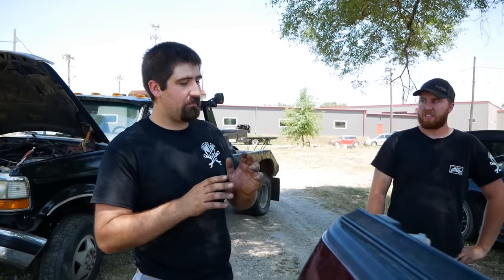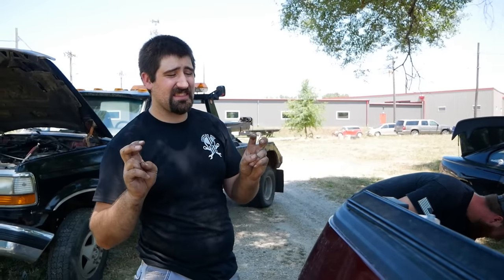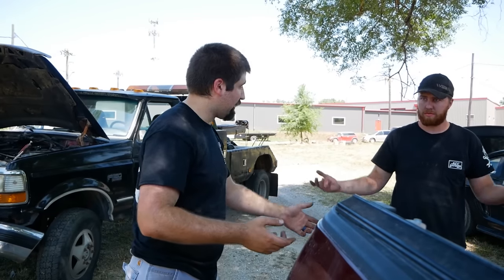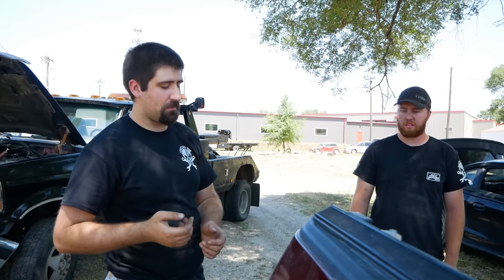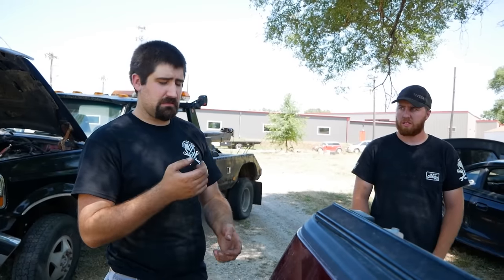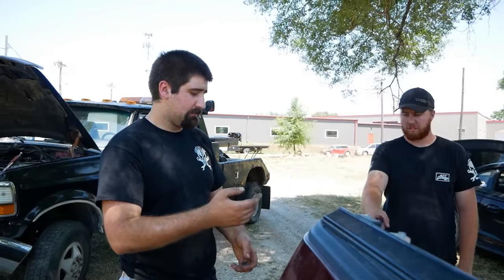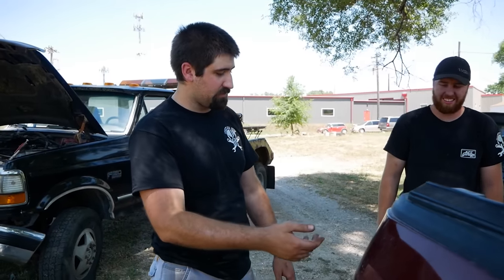Exactly. Running biodiesel can be a quote-unquote bad thing, but you only run into issues with that in colder climates, like Iowa in the winter. I run into it a lot, where these guys don't treat their fuel properly, or they bought pre-treated fuel which hasn't been mixed properly. The fat content tends to crystallize in the fuel quicker in the colder months, and it looks like this jug of oil. Looks like what we just did.